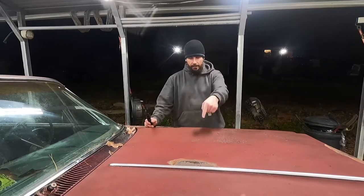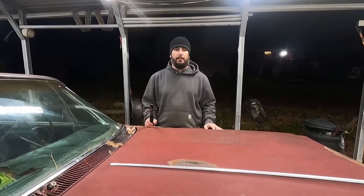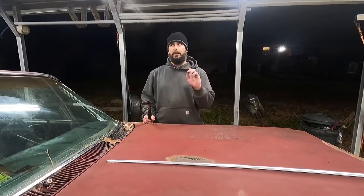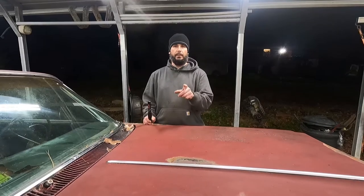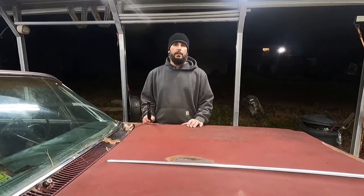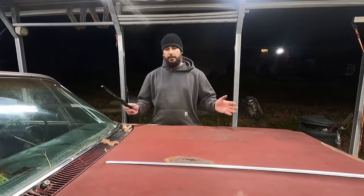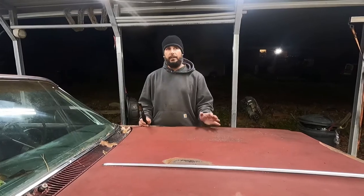Standing where I am right now, I could look into the cylinder head and read the casting number. There were 462 heads, but unfortunately water got in the motor, and I believe number two cylinder was the worst one, and it was stuck, and it froze and cracked a cylinder. The block can be sleeved. The cylinder head was pretty bad off, but those heads are from 66, which makes them nearly 60 years old.